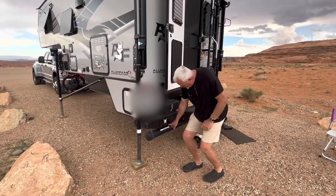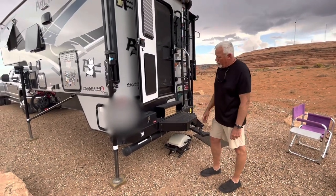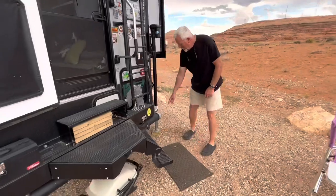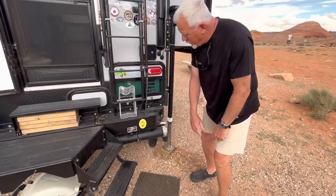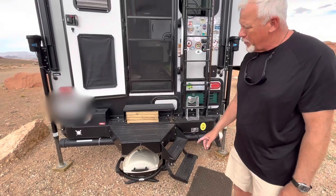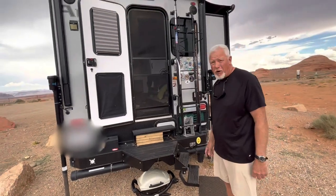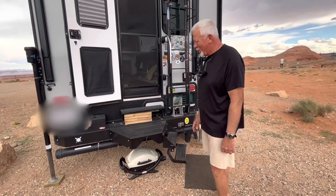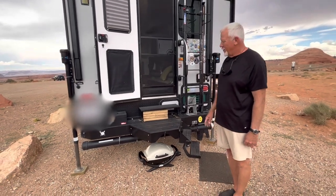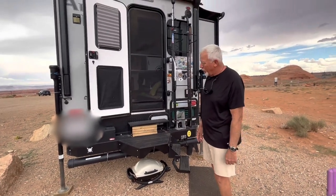The sewer hose is in here. I made an extra sewer hose out of PVC pipe — I hand sanded it, painted it black, put an end cap on one end, and on the other end I put a metal band and end cap as a heat shield for the generator muffler. I just wire tied it underneath the camper and drilled a hole or two underneath the bumper to hold the wire ties. It's been working really well. It works great as extra tube storage — maybe for a brush handle, telescopic handle, fishing rods, or long handle tools.